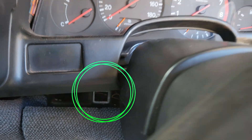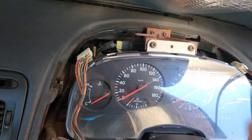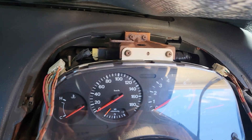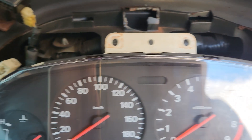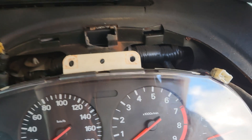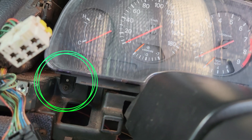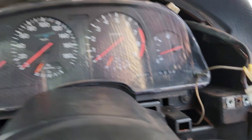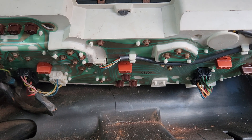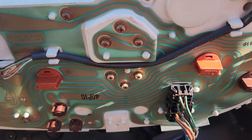The main shroud clips in at two square positions at the bottom. With the steering column plastic loosened we should be able to pop it and lift it up. With that shroud moved forward we can see it is still connected with wiring, so we can unplug the left and right upper plugs. Those two plug receptacles just clip into the top of the cluster — we can push them backwards and out of the way. Now there are two more screws holding the cluster in at the bottom left and right. We can undo those and move the cluster out forwards.